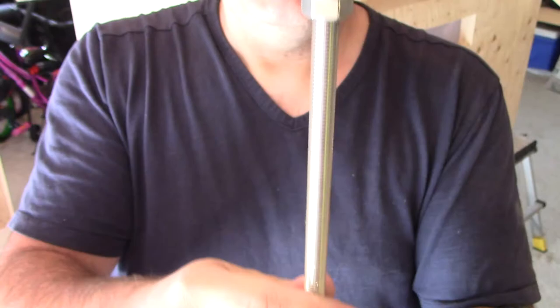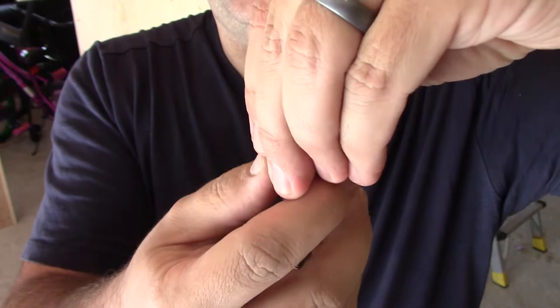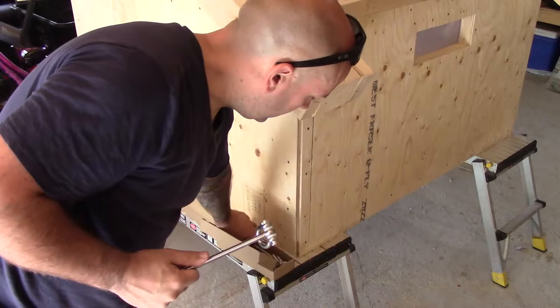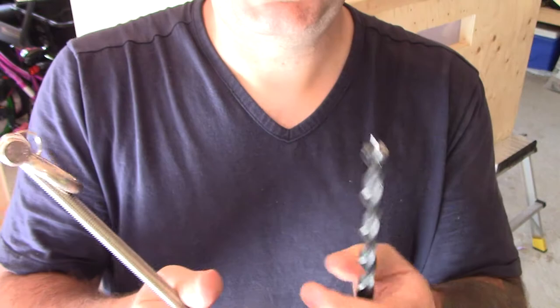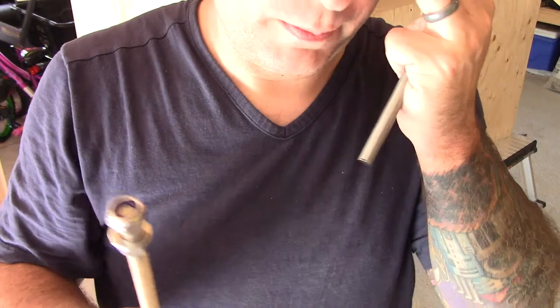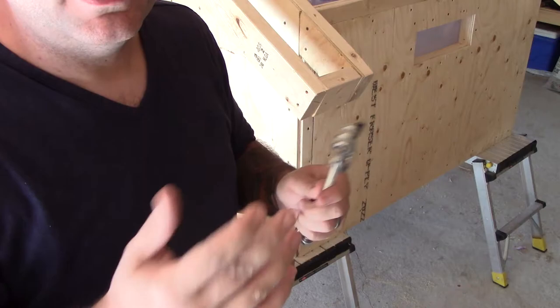It has a nylon lock nut at the top, and the washers are included. So we'll have one nut down on the bottom, and then we'll feed that up through the hole that we make in the cross member and then screw the top on there. And the nice thing about this kit as well is that they actually provide a drill bit, the proper size drill bit, so that was nice. So making sure that I drill my holes straight down through and at the proper widths. Other than that, it's as simple as drill a hole, put in the threaded bolt, tighten it down, and you're good to go. Alright, so that's what's going to happen next. And as far as measurements go, I may get into that, but otherwise you may just see me drilling the holes, putting on the mounting hardware, and call it done.